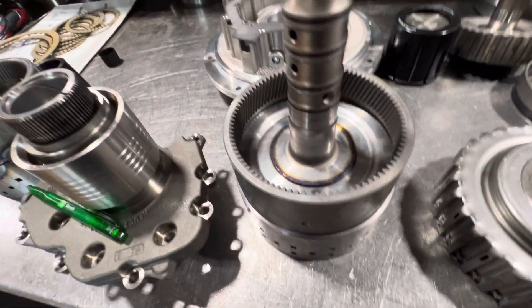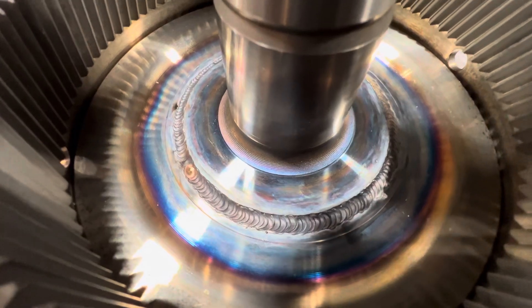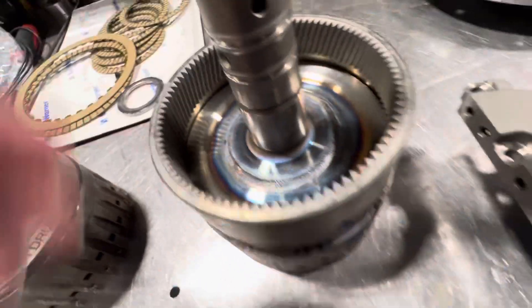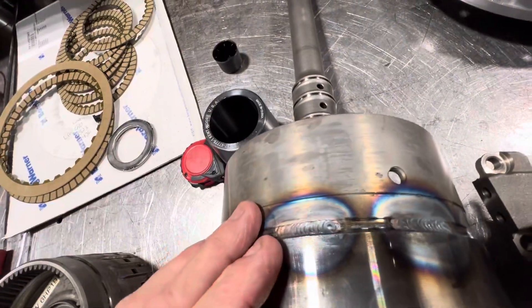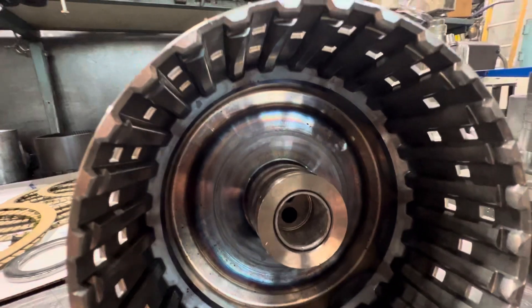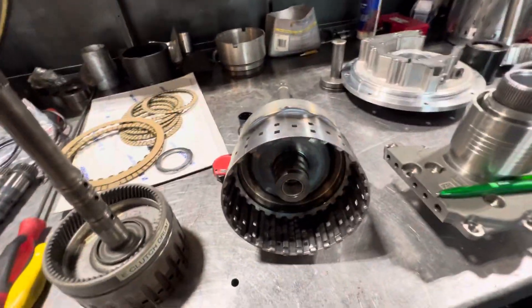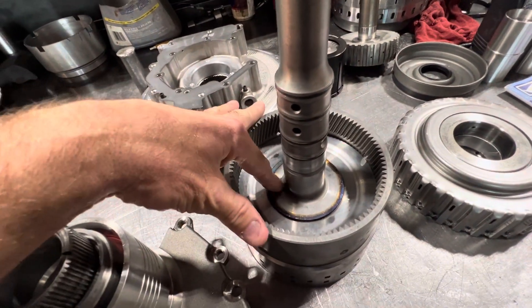What we did, instead of just putting a new one in, we took it and actually increased the amount of weld. We welded this side — the stock one is only welded from the bottom side from the factory. We also weld the two halves together: the clutch housing half and the ring gear half. The factory weld is very, very small — not a whole lot connecting those two pieces. That may work fine for a stock application, but as soon as you start to lean on it, that's when things go south due to the limited torsional capacity of the connection between the shaft and the housing.